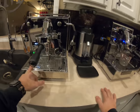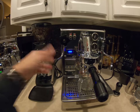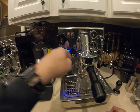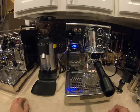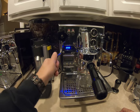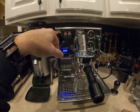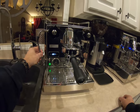They both have PIDs. On the Brute, the PID is only for the coffee boiler. In a dual boiler, you have one boiler for brew and one for steam. The PID lets you set the temperature of the brew boiler — so you set it to 200°F for consistent extraction. Steam requires around 250–260°F. On the Brute, to change the steam pressure you have to get inside the unit.